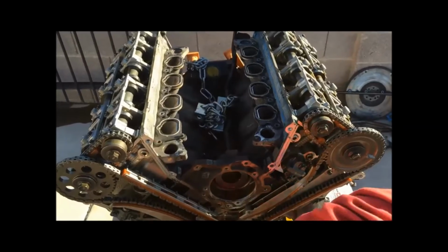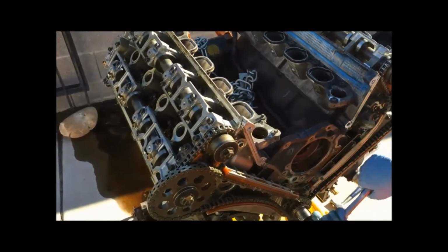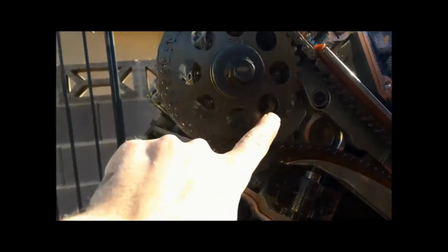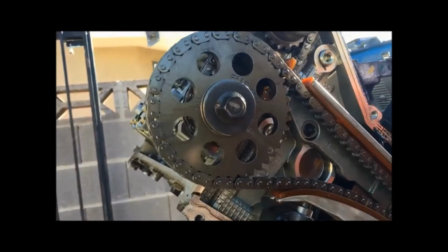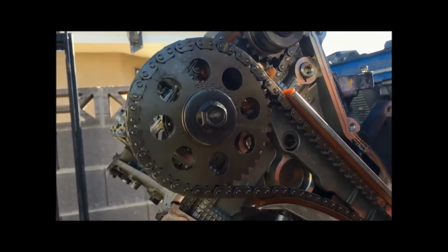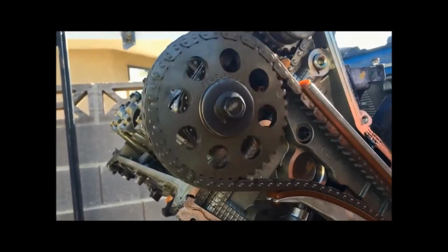So what I'm going to show you next is a cylinder head that's off of the car, and I really can't move it, but I have some in the right spot. So you'll have the advantage with the engine still together that you'll be able to turn these and get those lobes back and forth exactly in the position that you need. So once again, it's an 18mm socket on the crankshaft pulley, or if it's an 0304 Cobra, you'll be putting a 14mm hex inside the crankshaft on the stock lower and rotating it.